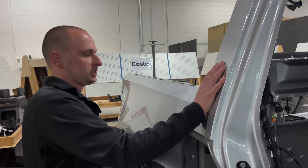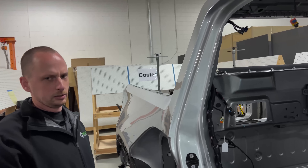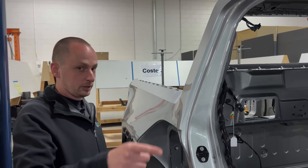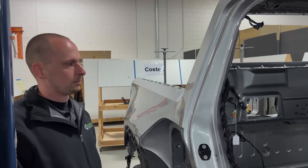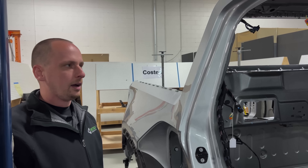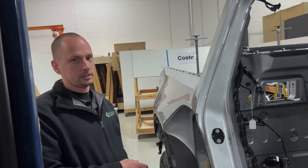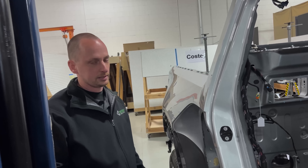In the C-pillar here, according to the NFPA manual, there is a 12-volt cut loop inside the C-pillar. There's one up front in the powertrain bay, which is normal, but to have one inside a pillar is a bit unorthodox. I'll give Rivian credit for that, because it gives first responders another access point to cut power in a collision in case the front is not accessible.